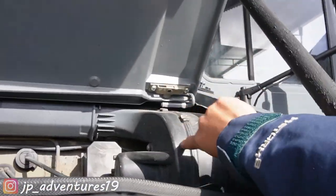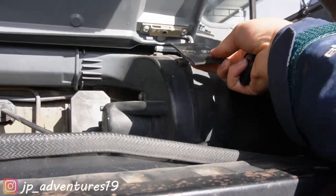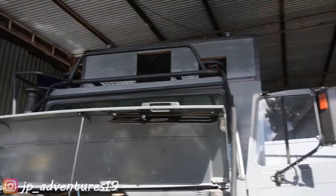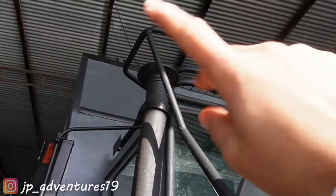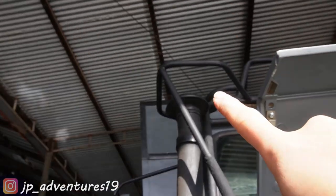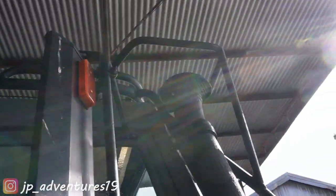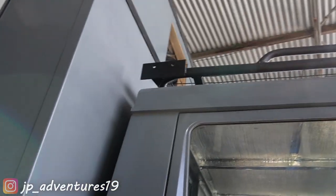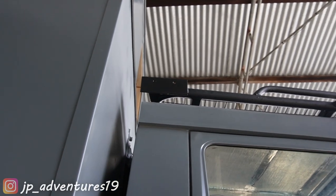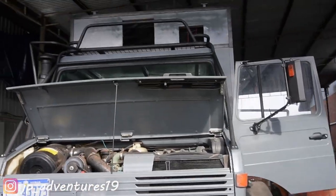Now we have to take this part out to get to the last side because our hand doesn't fit through the gap. Then we can mount this, and then mount the top through the roof, and we're all good — never ever taking this off again, hopefully. On this side we created some bar work that goes around the snorkel head, but we might change our snorkel head so we had to leave a bit of room up and to the front. We still have the overhang that goes on here until here — that's why this bar ends there. And we have those plates on either side so we can mount a ladder that we still have to build, so we can climb up and down onto the roof.